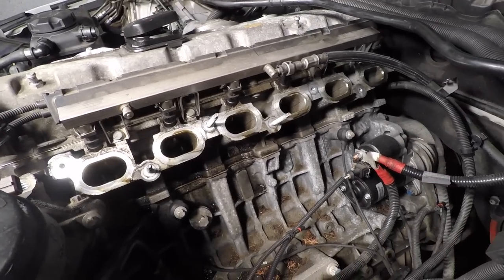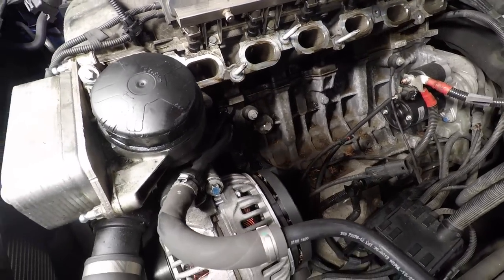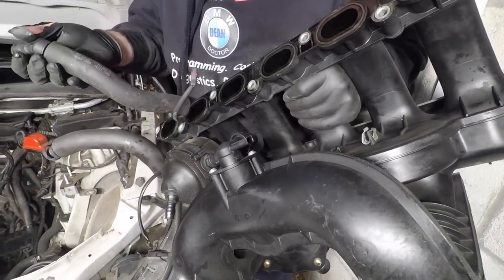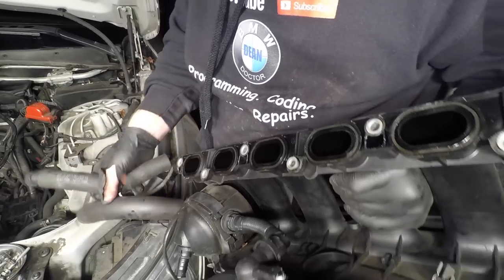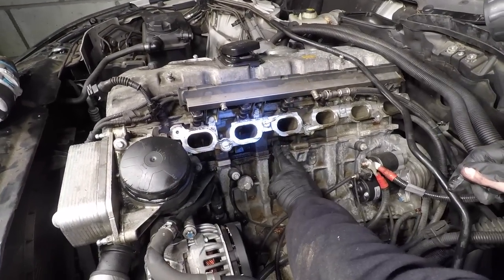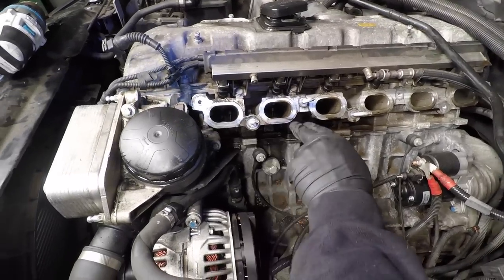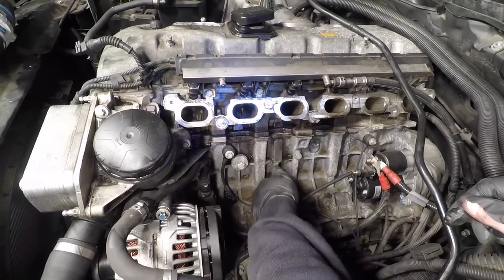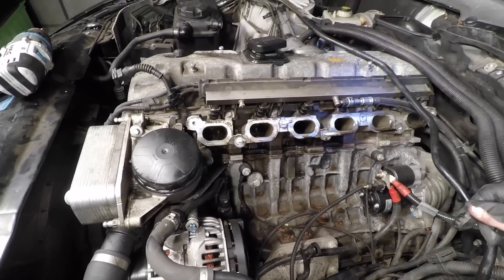Oil is all around the manifold, which are signs of a blown PCV. What I think happened is they took this off, didn't refit the PCV properly, and it caused an oil leak. Now I'm going to fully inspect around the engine. This is an original BMW CCV — as you can see it says BMW right there — and it's never been changed, hence why it's failed. Most people think the oil running down the block is a blown head gasket — it's not. The oil has been leaking past the intake manifold gaskets, leaked down from where the PCV ruptured and blown, and leaked out onto the block.